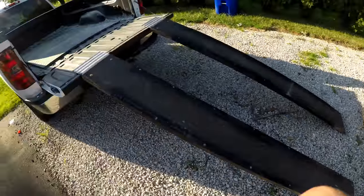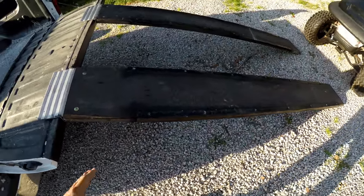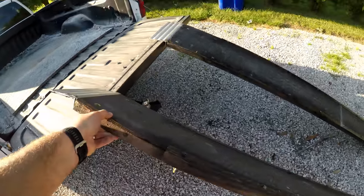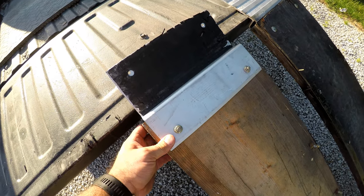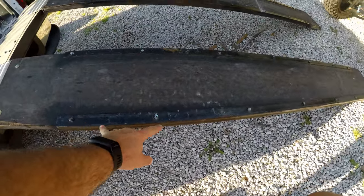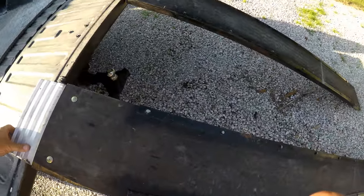So I had to mod it even further because when I was driving this up, the ramps actually bowed. Anyway, these ramps are pieces of aluminum — you have a front piece that's bolted onto the bottom side of our 2x12. It's pretty sturdy and I've been very pleased. The only thing I've done to make sure these don't get broken is I've added some angle iron, bolted about every 12 inches down. It's tedious, but looking at comparable foldable ramps, I just couldn't justify the cost.